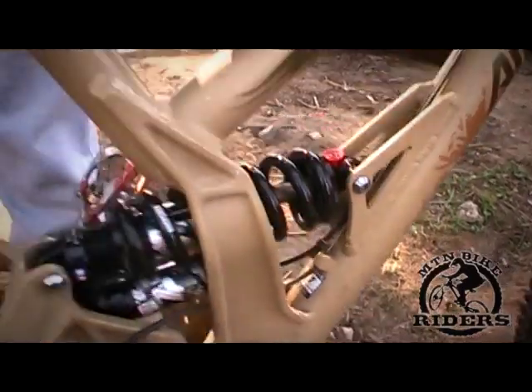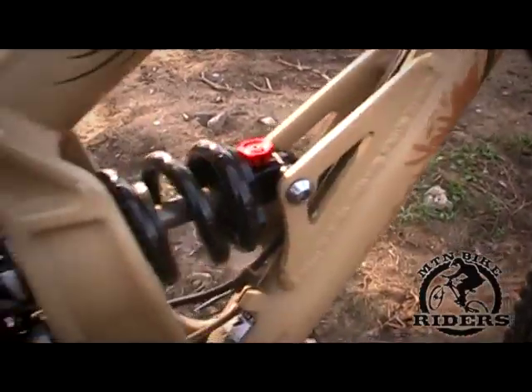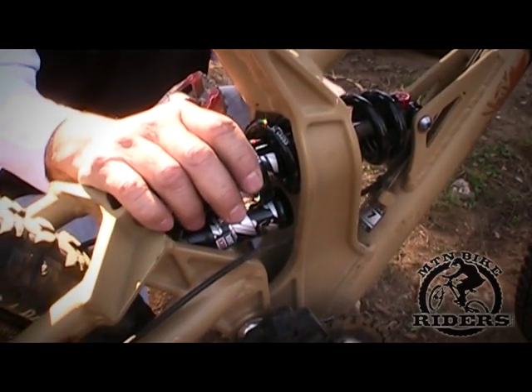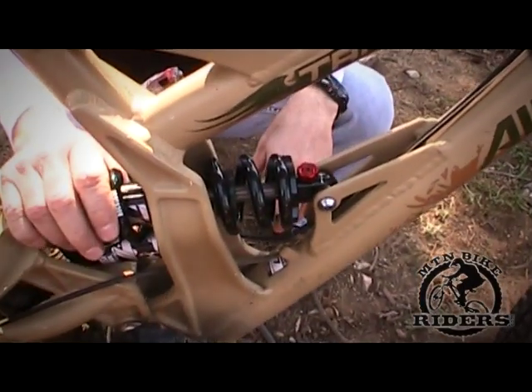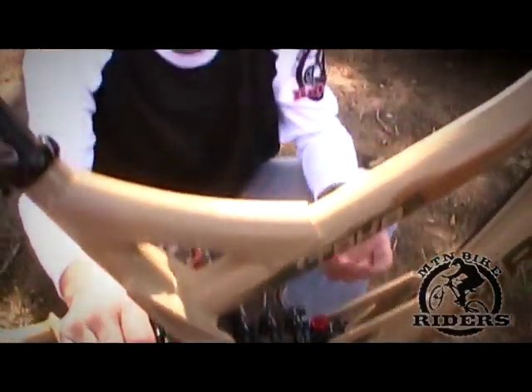This was a little on the slow side, so I'll click it up one or two more clicks. That feels a little bit better. RL has a 550 spring on here, so I've got to wait until he tries it out and sees how the rebound feels. We're at about six clicks out now — out of 13 total — so we're about halfway, starting into the faster phase of the rebound, moving toward the rabbit setting. We'll go out for a test ride and see how it feels. If it's reacting good we leave it alone; if it's still too slow we'll take it up a notch. Don't adjust by more than one notch at a time so you don't overdo it.